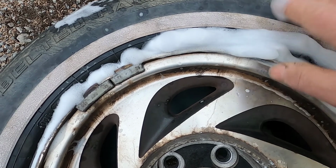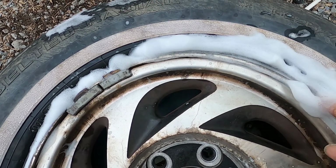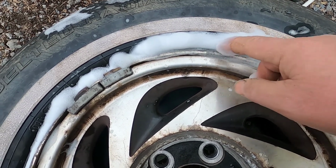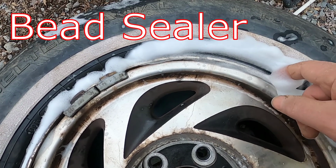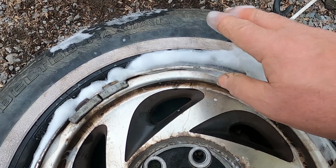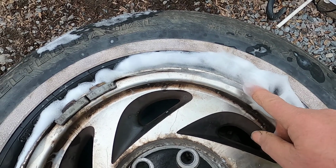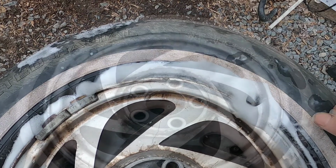But that said, I'm gonna have to take this tire off. I'm gonna have to break the bead on this tire, clean it up in here, see what it looks like after I clean it up. And I may have to buy, they have some tire sealer that you could put on. After I clean up the rim and the bead on the tire, I'm gonna just inflate it again and see if it leaks. If it does leak, I'm gonna have to put some tire sealer on there. I will have a link for the tire sealer in the description below.